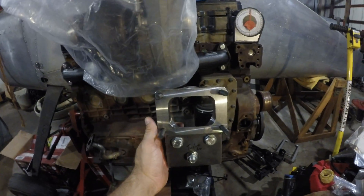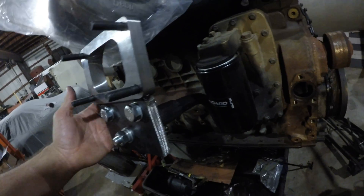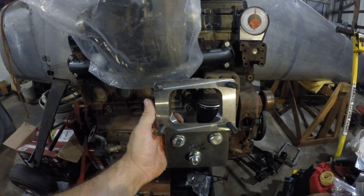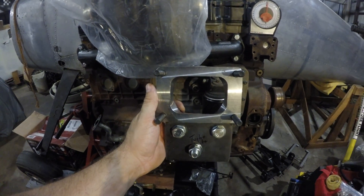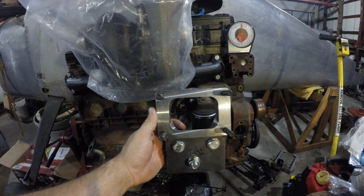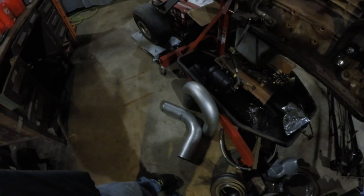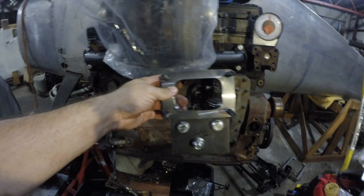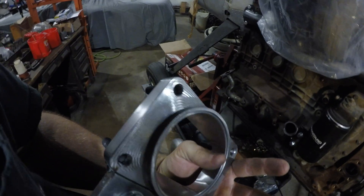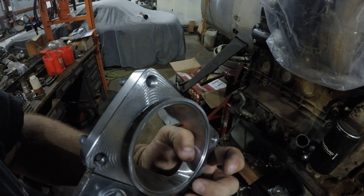Here's the contraption I've came up with now. This is where my T6 is gonna mount for my S500, and I've got this sleeve here — I'm gonna go mount it out on the truck and see how far forward I can pull it. I think I can get it about here, which will clear that S400 perfectly well. Once I get that done and all mocked up I'll come back in here and tack weld it, see how she looks, and if everything's good, finish welding and start building the hot side piping. Looks like I'll just need a U-bend and a 90, which I've got sitting down here — it's a three and a half inch pipe going into this T6 flange, with an adapter, so everything should go fine.